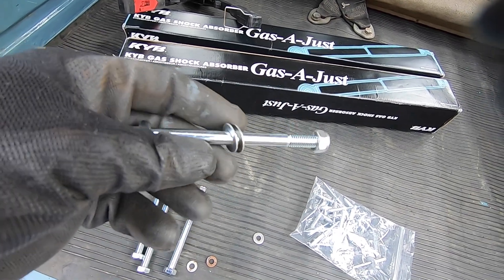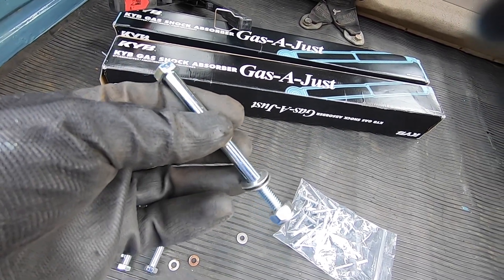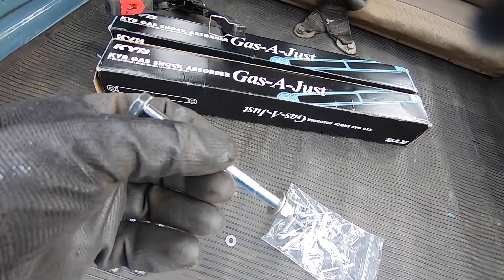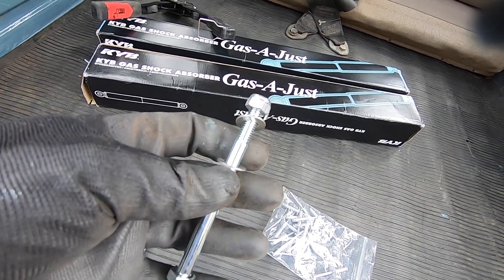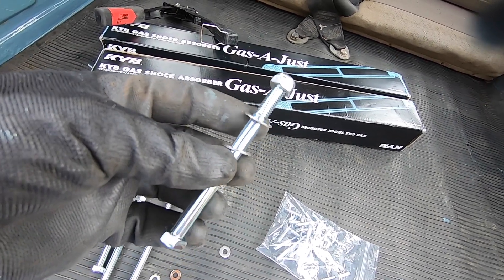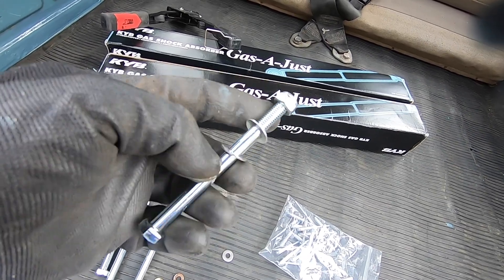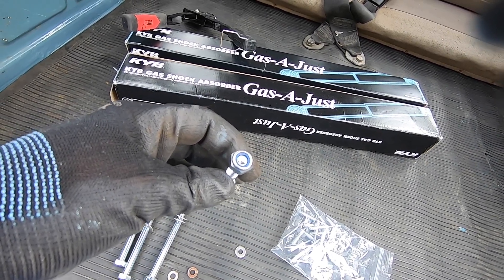The tow bar uses the bolts that secure the bumper hangers to the end of the chassis. The bolts on the car are pretty poor - not really quite long enough. So I've bought new ones which are 110mm where the ones on the car were 100mm, giving me a little bit more thread at the end. I've got the thickness of the tow bar steel and the thickness of the bumper hanger, and I should be able to get the thread to come out the end of that nylock nut. I'll show you putting those on in a moment.